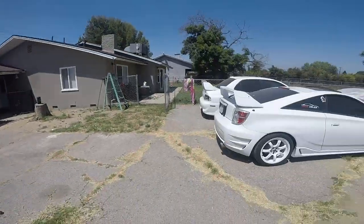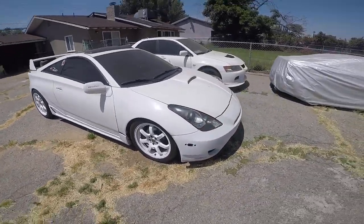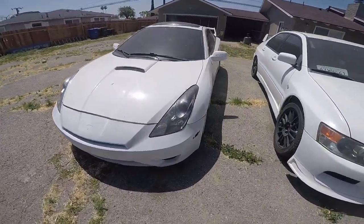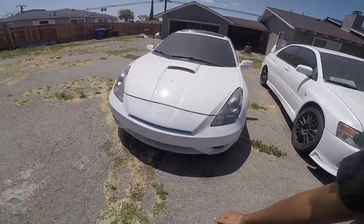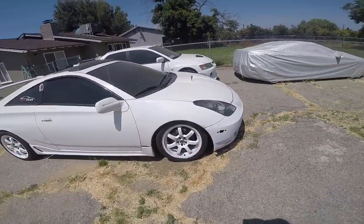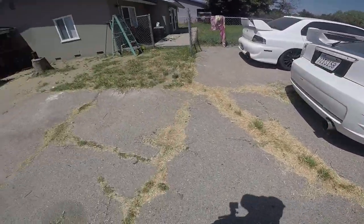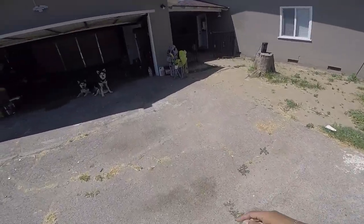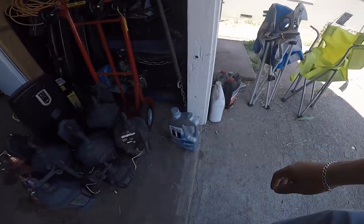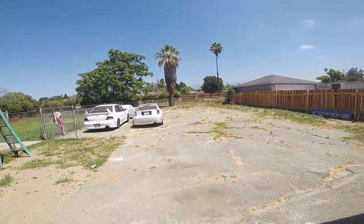Welcome to Rafa's garage. Doing a quick oil change on my girl's car — after it overheated, the lifters are sounding pretty loud. I'm going to upgrade to thicker oil, going 10W-30. It doesn't necessarily need an oil change, but I'm going to do it to see if it helps out those lifters. They're a little louder than they should be. This is the oil I'm putting in, so let's get to it — should be very quick.